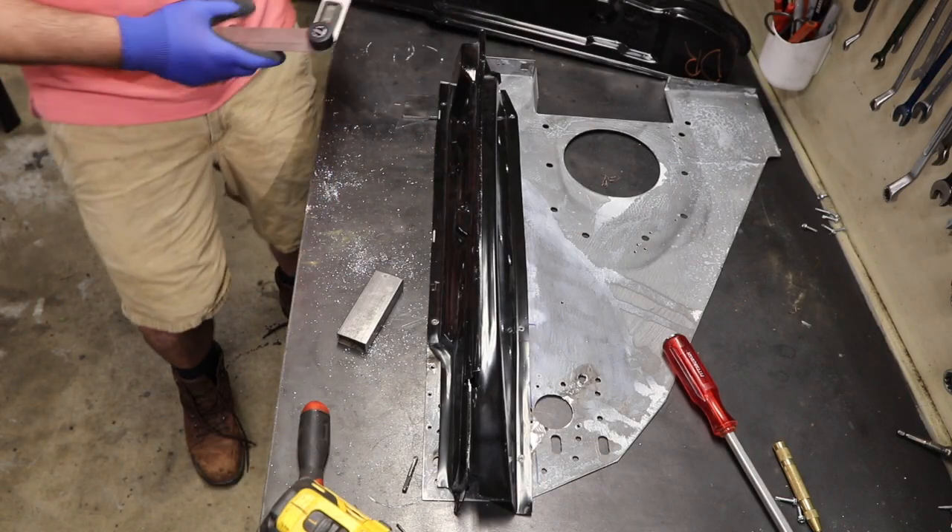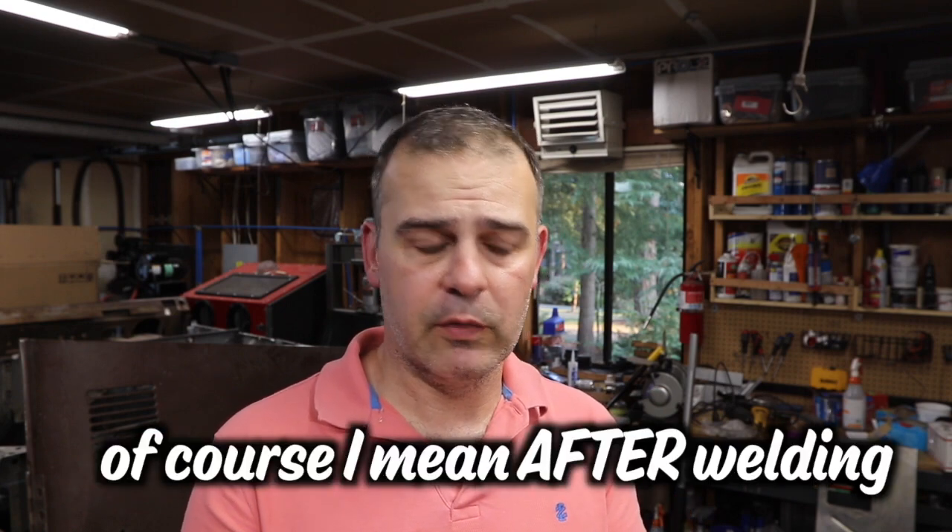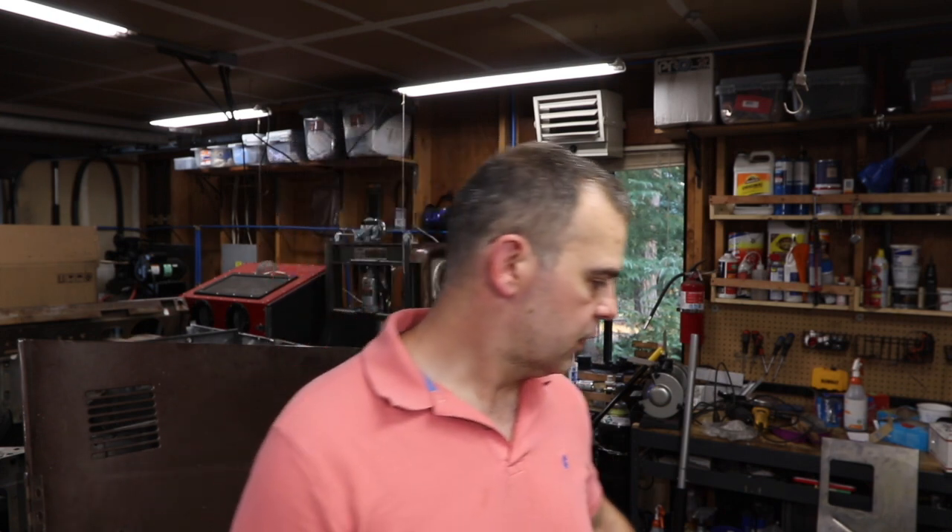98.7 degrees — close enough for a Bronco. Thank you, Phil, for walking me through how you did it. Please comment below if you think I screwed something up, and to all my viewers watching, make sure you read below in the comments and see if Phil says any warnings, because he's the expert — I'm just a tourist trying to make it look a little pretty. When you're doing this, you're going to be welding inside a prepped panel, so make sure you prime inside and paint inside to prevent it from getting rusty. My wedges are raw steel, so I'm going to acid etch them and then prime them so they'll be nice and durable — Gavin might need to redo this in 30 or 40 years, but it'll last until then. Thanks for watching — make sure you like if this helped you out on your Bronco build, and see you next time on Matt's Garage.